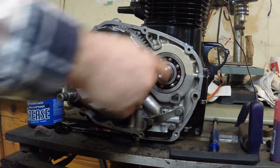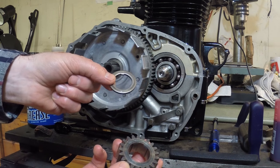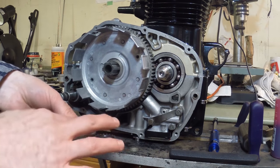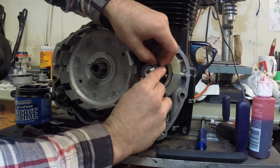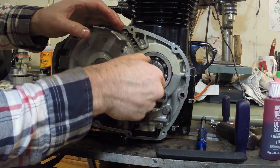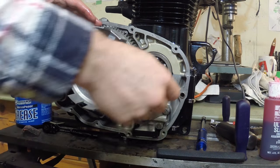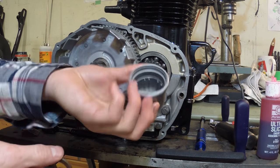The next thing we need to do is install the primary drive for the oil slinger. I have my primary drive here, and this is called a thrust washer — the thrust washer goes on first, then the primary drive. I'll give it a little bit of grease just to help it stick. The thrust washer has these little grooves so you just have to line them up with the end of the crankshaft. With the primary drive, slide it in over the end of the crankshaft and line up the teeth with the clutch basket. That won't move now because it's going with the rotation of the engine.